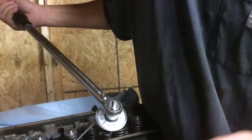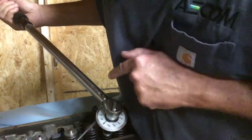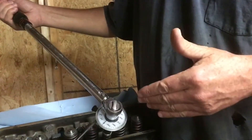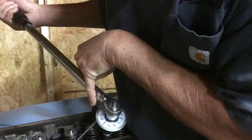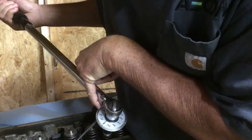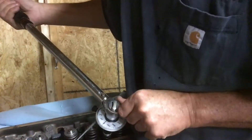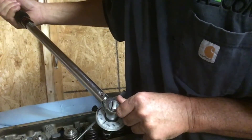This is a long bolt so it goes 75 degrees. You need to figure out where you have to stop before you start — don't try to figure it out as you go. Right there is 60, so one major notch past 60 is 70, and halfway between that major notch and the next is 75. So I'm on zero right now and I'm fixing to tighten this to 75 degrees.